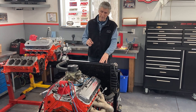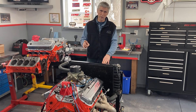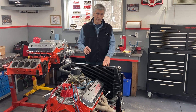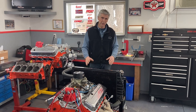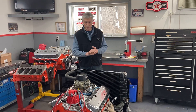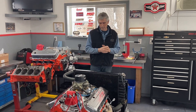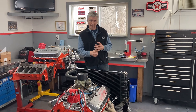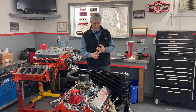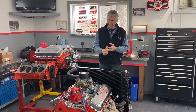The point to make is, if you've got an engine that you don't know about and you've got a flat tappet camshaft, you do not want to turn that engine over any more than you absolutely have to until the camshaft is broken in. This engine has a flat tappet camshaft. So, by the time I brought it back to my shop and degreed the cam, now I know dynamic compression and compression pressures, and I need to know a few other things to make sure I can start it up safely.